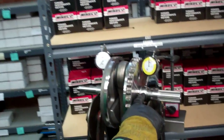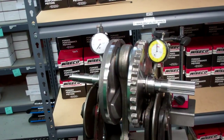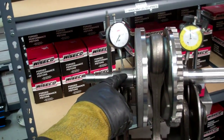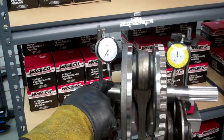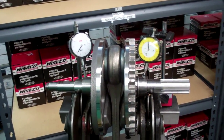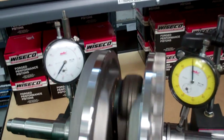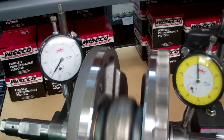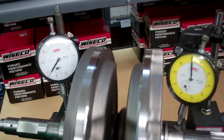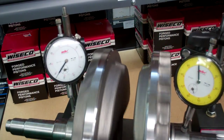This area right here is where your bearing runs in your left case. This area right here is where your bearing runs in your right. This is your pinion shaft race, and this is your sprocket shaft race. Those are the two areas that we focus on being true. As you can see right now, this crankshaft is within a half a thousandth on the sprocket shaft side and virtually three-tenths or so on the pinion shaft side.